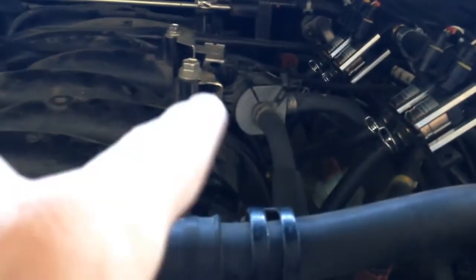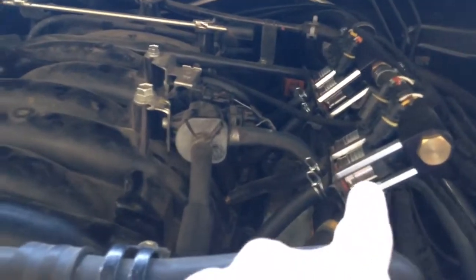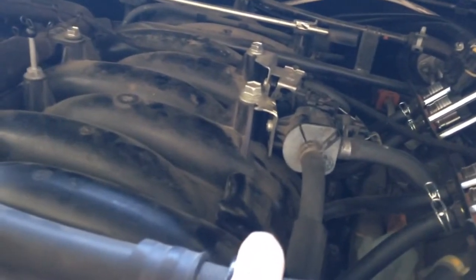Remember, we don't care whether it's one, three, five, seven on the driver's side or one, two, three, four on the driver's side. All we want to do is correlate the CNG injector A with the first cylinder first position here and the corresponding injector cutoff harness.